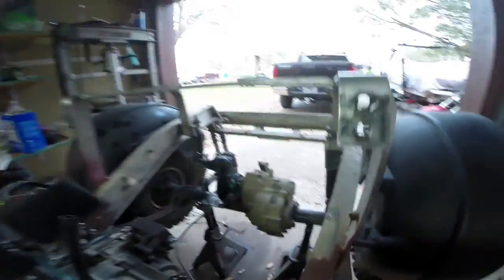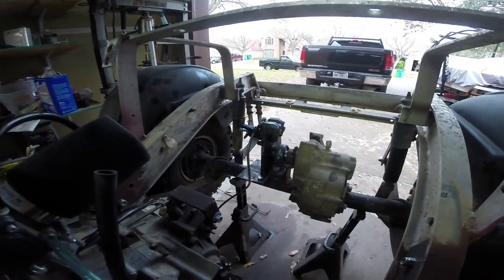Even with that it took a good 30 minutes of running the compressor, letting it build back up, then running it again and again. We got hydraulic pressure — the only negative I see so far is we do have a little bit of brake flex. Not ideal in a performance situation, but I think it'll probably work okay for stopping the golf cart. We won't really know until we go and drive it around.